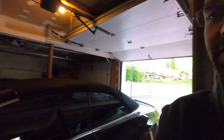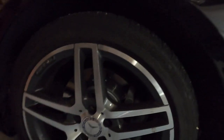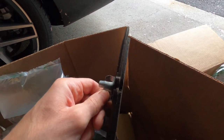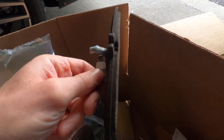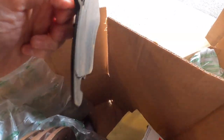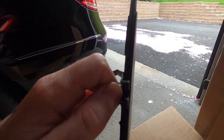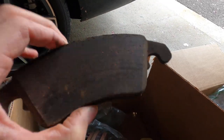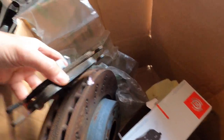Next day here — ended up getting caught up on the phone so I stopped recording the actual brake change. But there you have it, new brakes. Took it for a quick spin around the block. Here are the old pads. Looks are deceiving — the outside pads looked like they had more meat, but the inside pad had very little. In fact, the inside pad from the driver's side literally had maybe a thousand miles left on it, while the outside had a huge amount difference in wear.